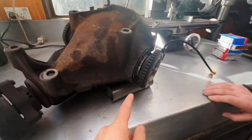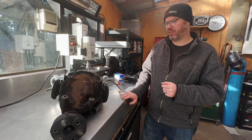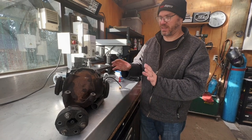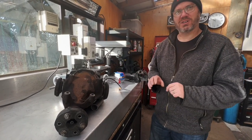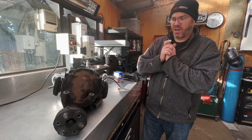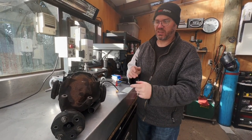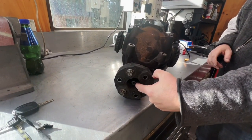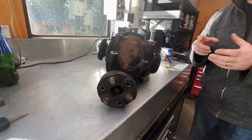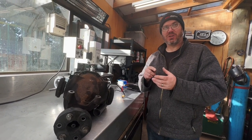I did spend a considerable amount of time on the internet looking, trying to find the appropriate information. And in the end, I decided that just common sense and experience was sufficient. So I've put it back together, assembled it with sufficient... Well, it's a Holden, not a Bugatti. That is correct. And I found many comments on many Holden forums suggesting that if you mark the nut in here relevant to the flange, and then you take it all apart and you put it back together and you make sure the nut goes back onto the same mark on the flange, that would be sufficient. Yeah.